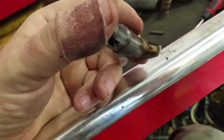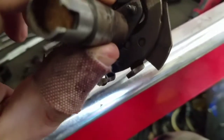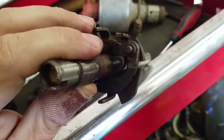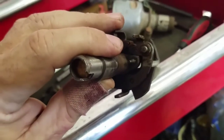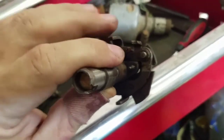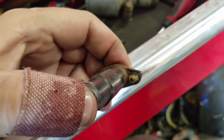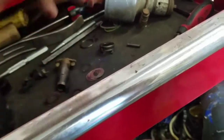If I goof up and go too far it'll be fun taking it apart and putting it back together. You can always bend the limiters — these limiters are also used on turbo cars to make sure the advance doesn't go too far; you can back it down and limit it. Anyway, I'm going to take this over to the bench, grind those down, and we'll see how it works.